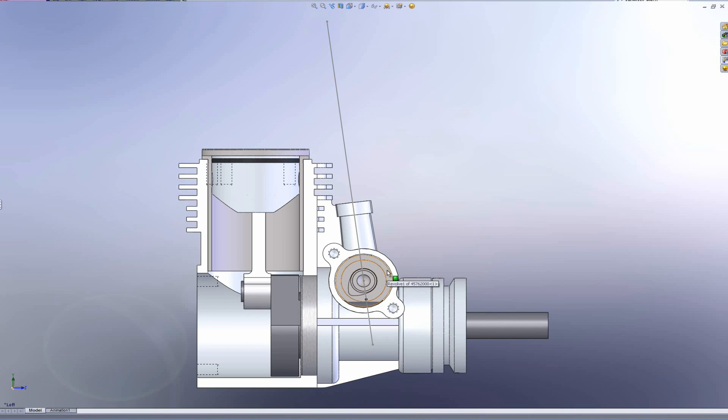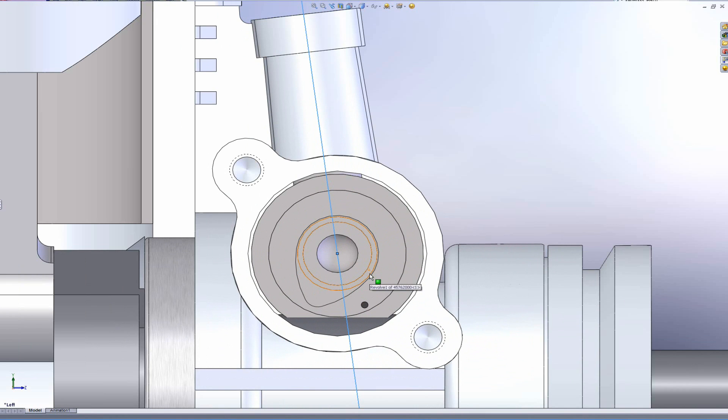The cam twists a bit when you're installing it, so you'll have to pay attention when you put it in. If it's off by a tooth or so it's fairly obvious — you're looking at the axis of the cam follower bores or the push rod tubes to align the dots, and that will verify if it's about a tooth off when looking at an actual engine.